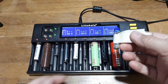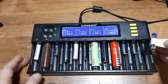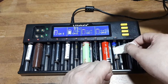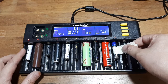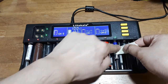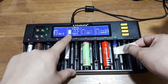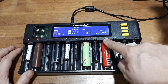My one concern is this is an alkaline battery — it's dead, but I'm going to pop it in with some tape so I can yank it out if it gets warm or catches on fire. It's actually charging this alkaline, but I don't think it's supposed to. It just jumped up to 100%, and this is a dead battery. So that's a bit of an issue — it cannot recognize an alkaline and give an error warning.